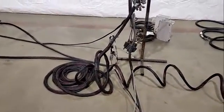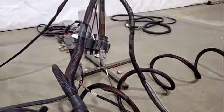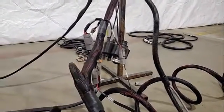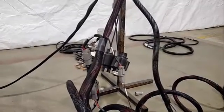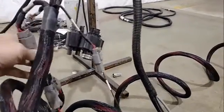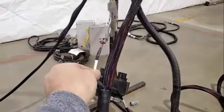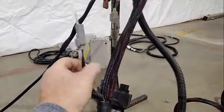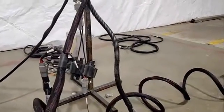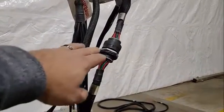The first thing we'll come to is the ECU breakout, which will be somewhere in the middle of the drill. The ECU breakout will be identified. There will be three small plugs at that breakout as well: what is labeled as a whisker switch, auxiliary power, and your safety loop. The safety loop is going to have a little loop cap on it — it has to have that cap or the unit will not function. It will also be identified at that T by this large ECU breakout harness.